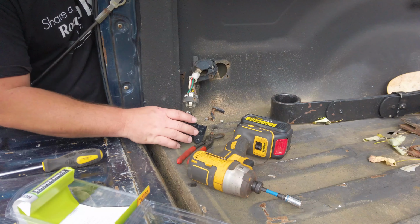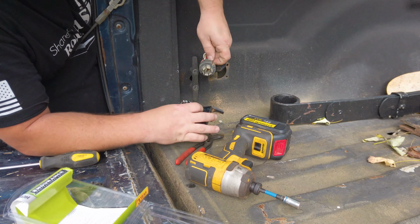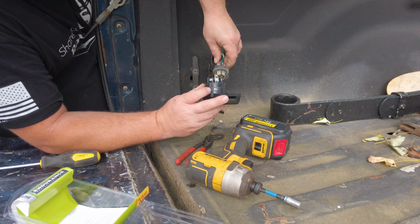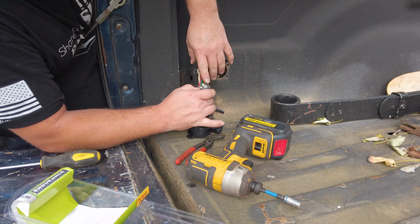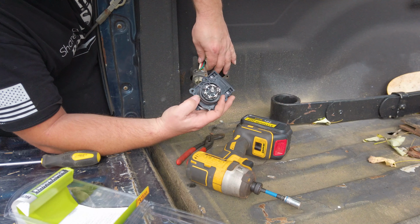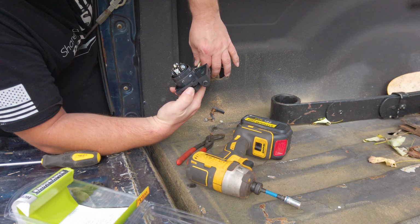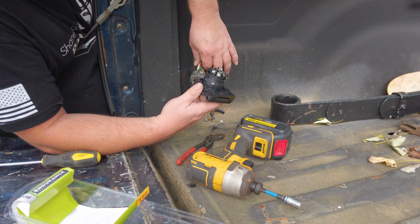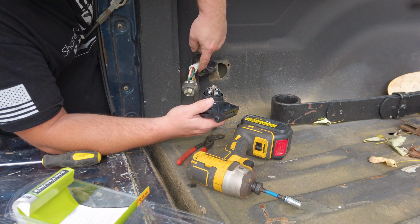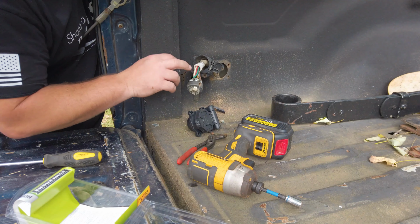Okay, and these plugs are designed differently as well. Brown is your tail markers, which would be right here. And then the next pin on this new plug is left turn, which is green. And on my old one, the black is right next to the tail marker. Black is not used commonly. I think it's supposed to be reverse. No, maybe it's your power, your auxiliary 12 volt. But anyways, it's not used. I saw the black wire down here.